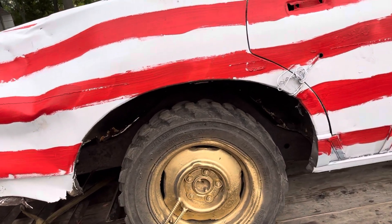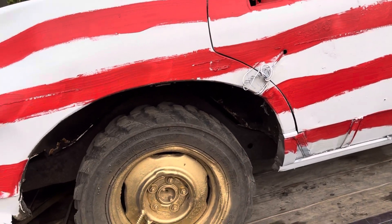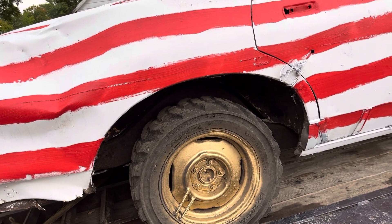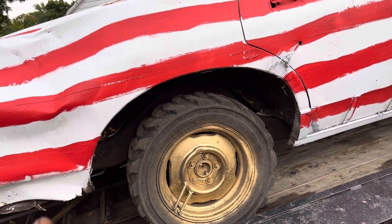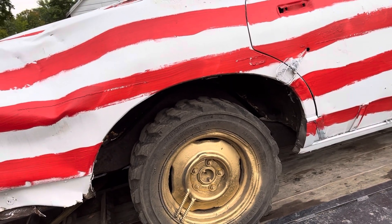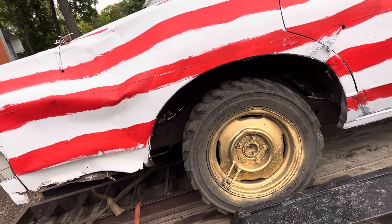I got some skids on the back. The frame is notched. I didn't do my creasing of the fender hump — I'm going to see if the hump goes a different way. I know doing that little bit of creasing is actually a good thing because on multiple cars I've done it, the humps don't blow out — they either blow in or they just compress and kick down a little bit, but they don't blow into the tire. A lot of times when I don't do it, it always kicked into the tire. So I'm going to see if that's actually true or not.